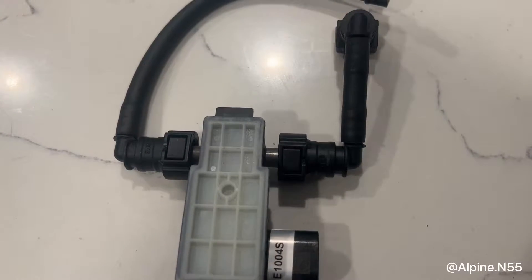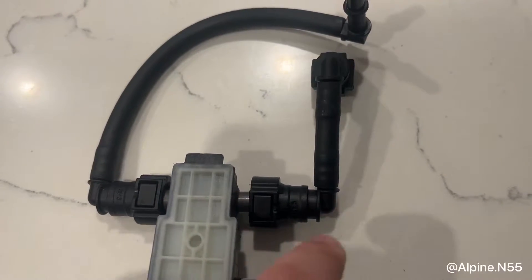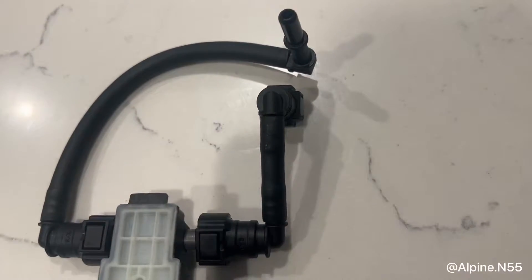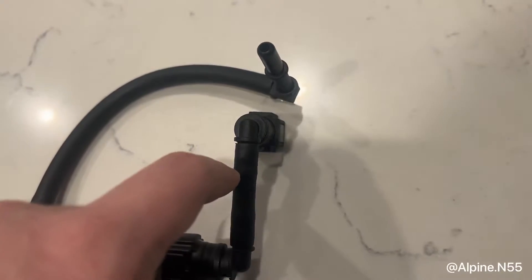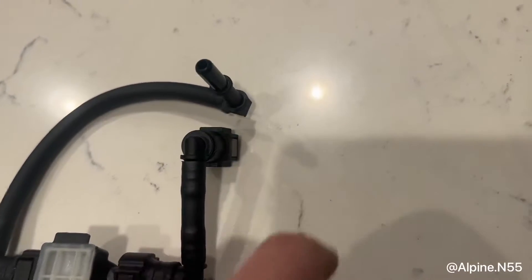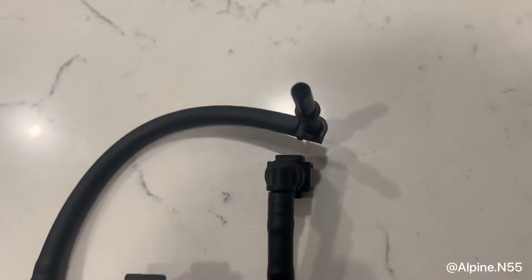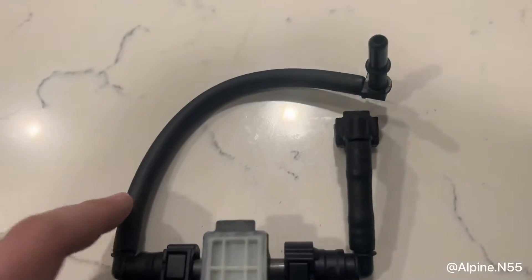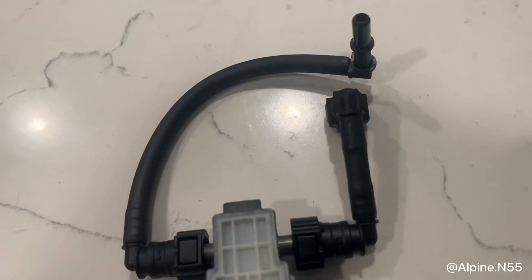The fuel line setup is pretty simple. It's a 3/8 inch barb, and another 3/8 inch barb on this side, outputting to a 5/16th barb that's going to a 3/8 inch fuel line. This is probably about 2 inches of fuel line, and then this piece right here is going to be a 5/16th barb, which is actually input of 5/16th as well, because the stock fuel line is 5/16th, which is going to sit on this part. This is probably about 5 to 6 inches of fuel line as well, and it's tilted to a right angle.